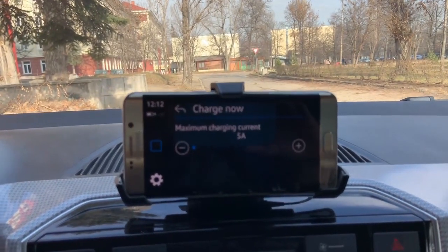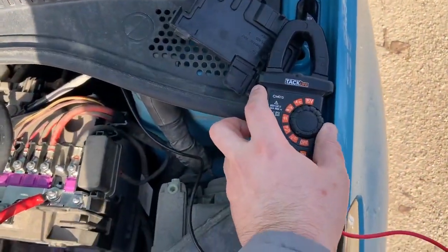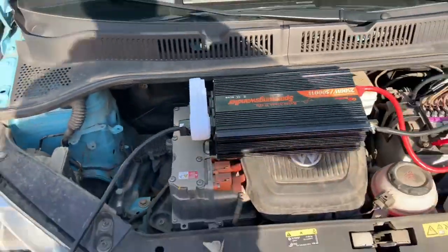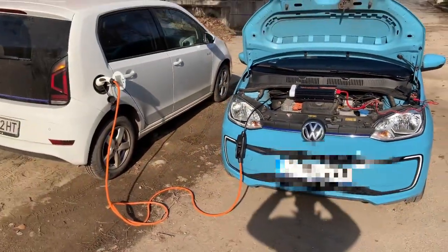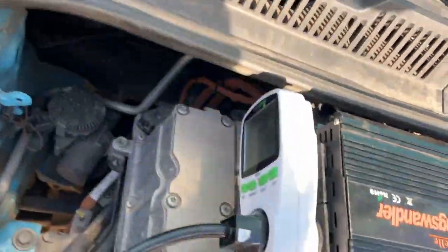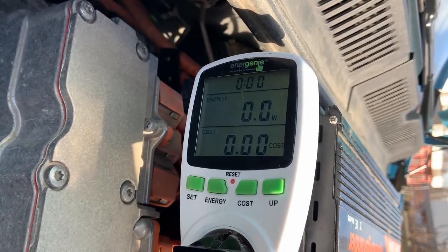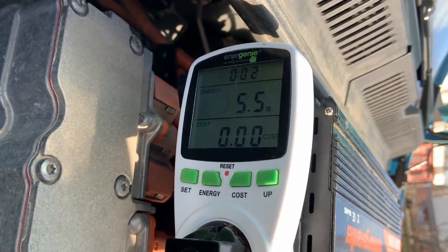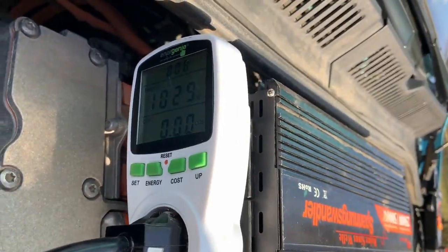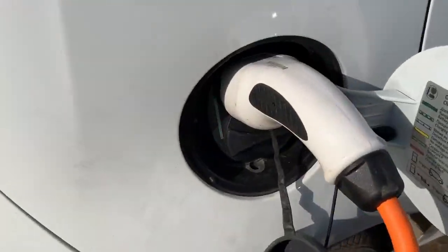I have set that already, so let's try the test. Okay, we are ready now. Let me turn on the multimeter here just to monitor the battery. Okay, it's charged. You can see the whole setup from my car to the other car. Let's turn on the inverter now. Okay, it's starting — it's consuming one kilowatt from one of the cars and charging my car.